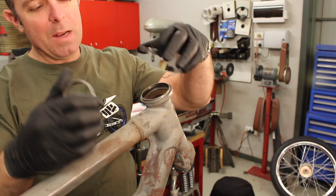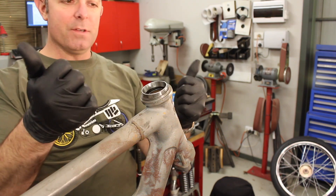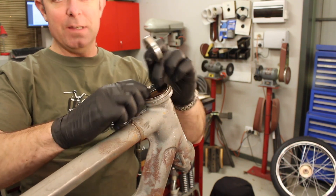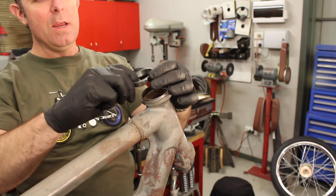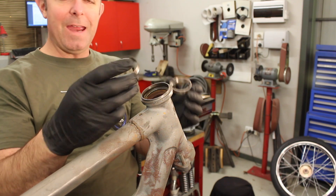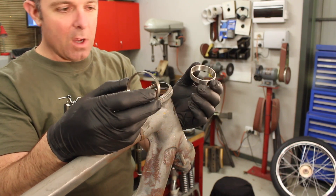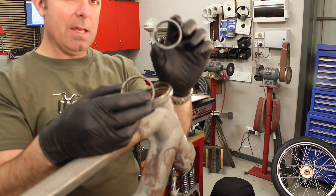With this adapter ring they were able to reduce the neck size down, use Harley bearings, and put a Harley stem and front end on this bike — a great solution. What we found though is after we chemically dipped the frame, the bearings have gone very loose in that adapter ring, and the adapter ring itself is loose in the neck. As the steering stem rotates, it could potentially pick up the cup and rotate it inside the ring, or the ring could move inside the neck — any of those actions causes metal-to-metal contact and wear, which reduces the diameter even further and makes the problem worse.